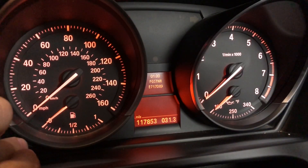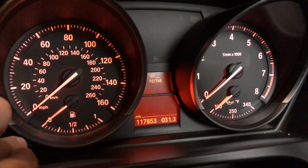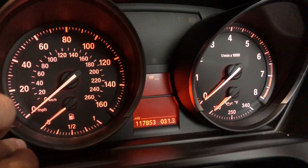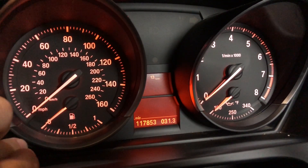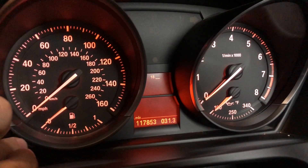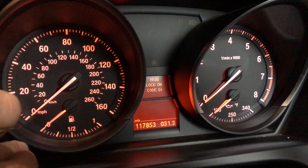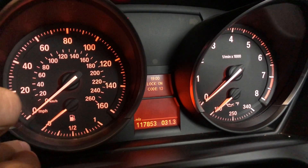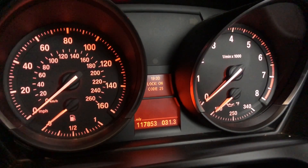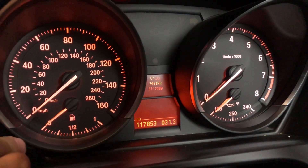To unlock the menu, we're going to go to menu 1.00, press and hold. Let go and then start pressing right away and get to 19. Once we're at 19, we have to enter a code. The code is actually going to be the last five digits of your VIN number all added together. So for me, that's going to be 25. You don't want to stop because when you stop, that's when it registers what number it is. 25, let go. There you go. We are now unlocked.